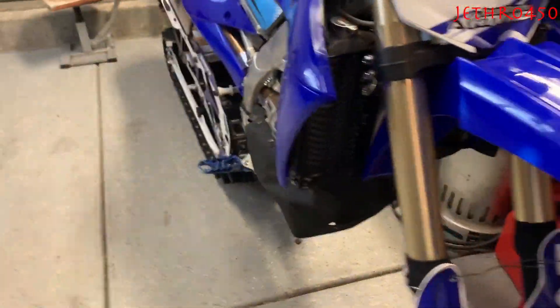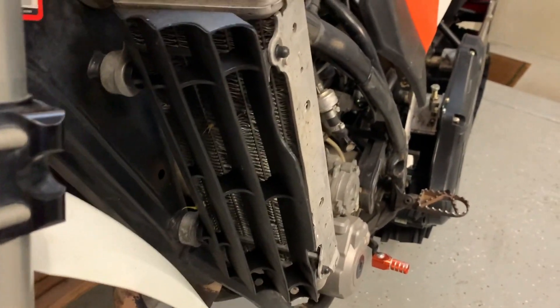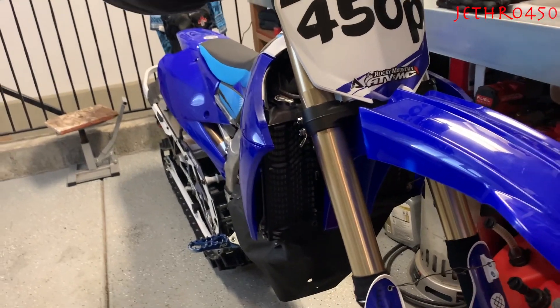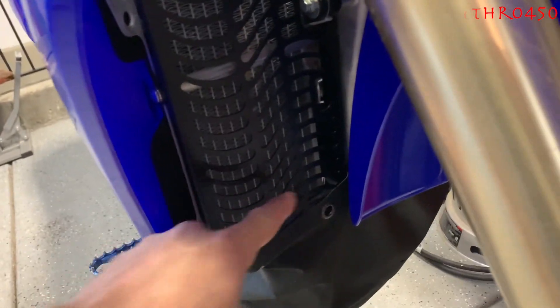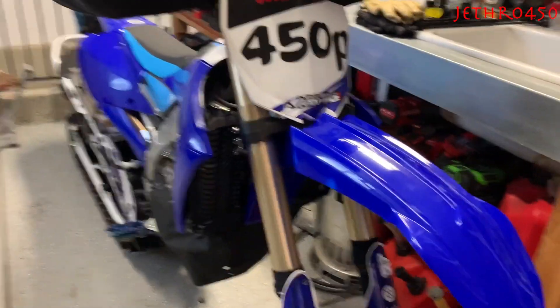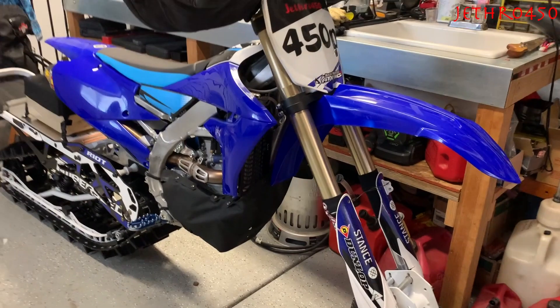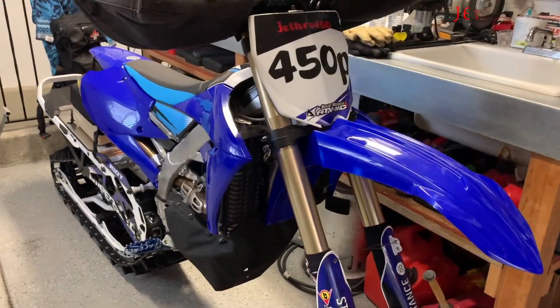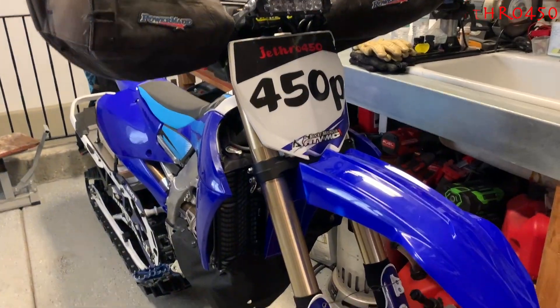I wanted to give an update on my radiator guards. They don't work as awesome as I thought they would, but they still work better than having plastic on there — plastic totally just gets packed up and frozen. When my buddies' bikes have had completely frozen front radiators, I still have probably 70 to 80 percent open; only the bottom edges have snow that never comes off. My radiator blockers make about a 30 to 40 degree difference in bike temperature. On the last ride with lots of powder, my temperatures were anywhere from 140 to about 170°F with both radiator blockers in.